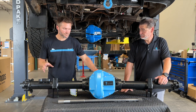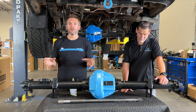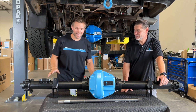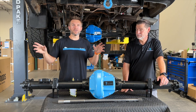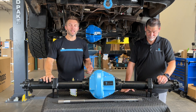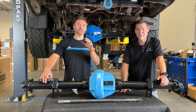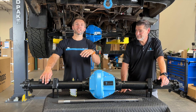The reason that's most effective is Mercedes has a bunch of what I'll call nanny sensors. These nanny sensors are there to protect the van from the drivers — God forbid we try to apply throttle to get over an obstacle. It adds up the torque being delivered to each wheel, and at a certain point we've all experienced in a Mercedes where we push the throttle down in four wheel drive and the van just will not apply throttle. We've worked to figure out why it does this and how to stop it — we can't yet solve it. But what we've found is it tends to add it up as a total, so if you put it into two wheel drive, it will deliver double the torque to the wheels before it cuts that torque.